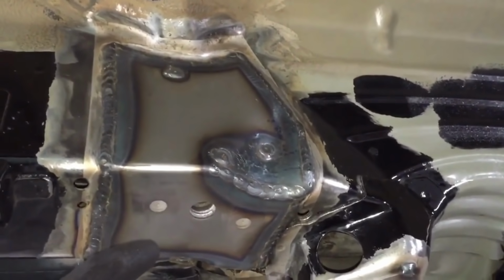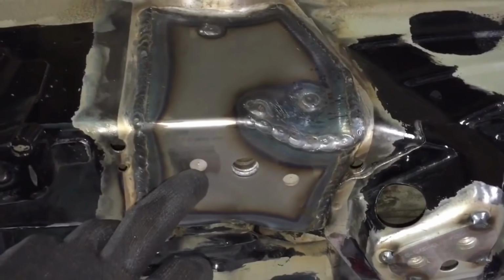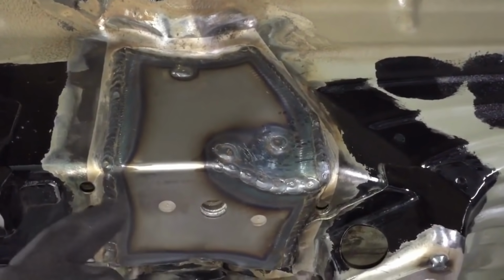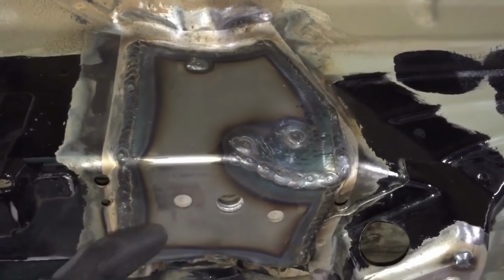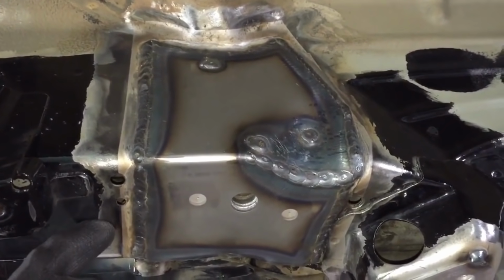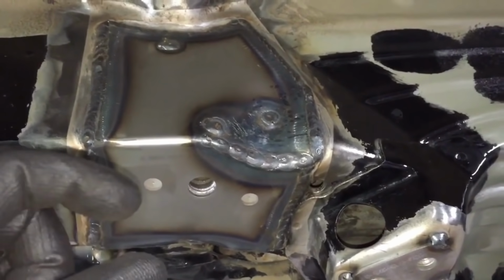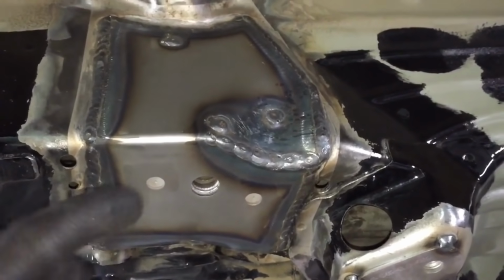So we specifically researched, by cutting one apart, the exact locations where plug welds would be beneficial to connect the reinforcement plate, the external skin of the rear axle carrier panel and the internal threaded mount all together in a 3-layer plug weld connection. So that's here.